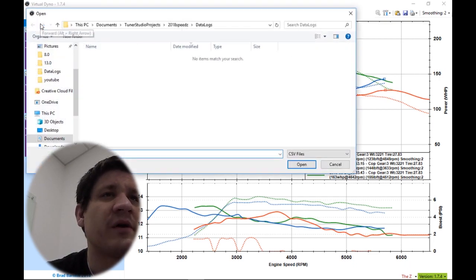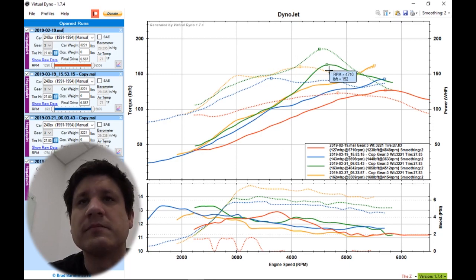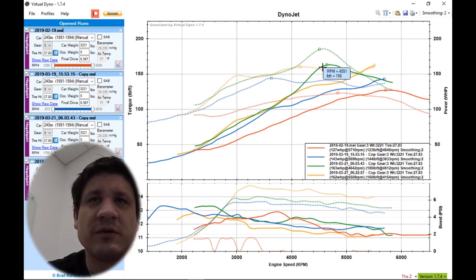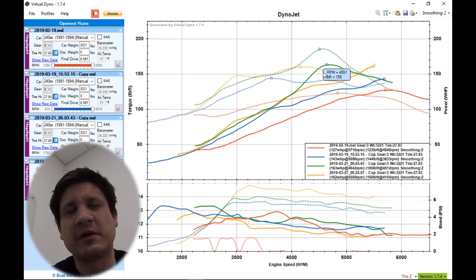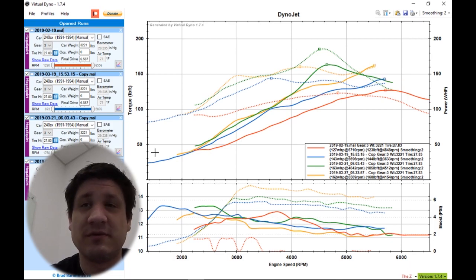Here's one of the most recent runs we did — kind of a happy medium. I've been able to get up there and get a little bit better, able to continue the horsepower pull to the end. This is just me working through things, making it a little better every day, getting it tuned out. The green one looks really great but it's lower because I was playing around with the timing. I backed off just a bit because I got a little afraid of what I saw on the spark plugs — I thought I saw little signs of detonation, probably in my head. So I backed off to play safe until I get a knock sensor. Speeduino was talking up a standalone knock sensor the other day, which looks really interesting — something I want to play around with.